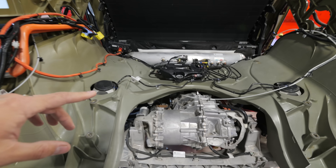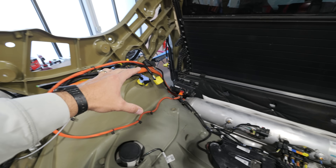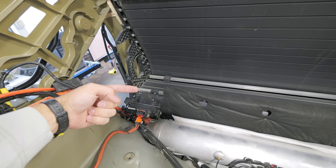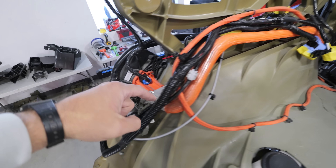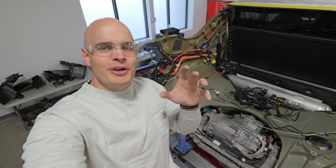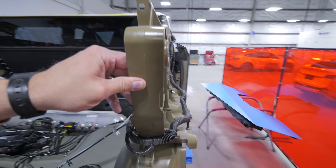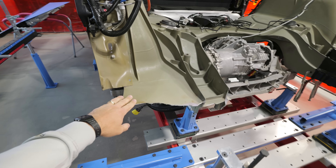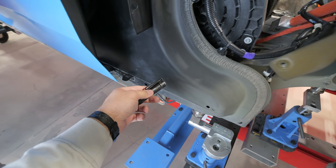Since it's taken apart and all opened up, let's look inside really quick. This right here is the compressor for the rear air reservoir, which handles the air suspension since there's air shocks on all four tires. Here's where the tonneau cover gets rolled up underneath. And anything orange is the high voltage system — so the backside of the NACS charging port is right here, and all the electricity goes through to that middle section of the Cybertruck where the battery is located. You might be wondering why the aluminum rear casting isn't silver — Tesla adds this olive e-coat paint over the aluminum as an extra level of protection against oxidation. Since there are both steel and aluminum components in the Cybertruck, the electric coat helps prevent galvanic corrosion where two different metals come in contact with each other.